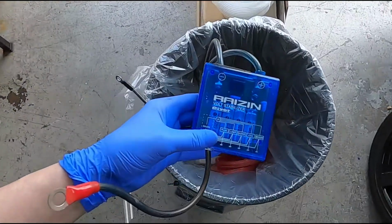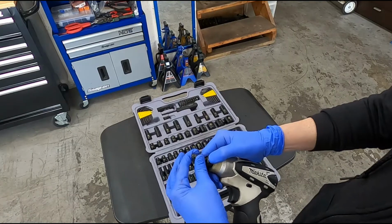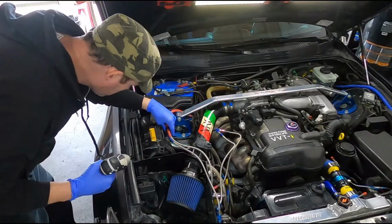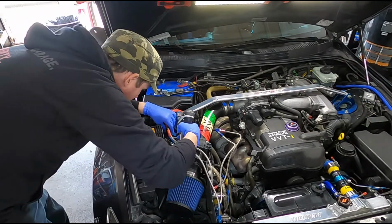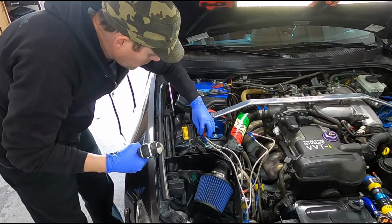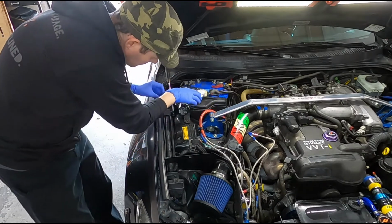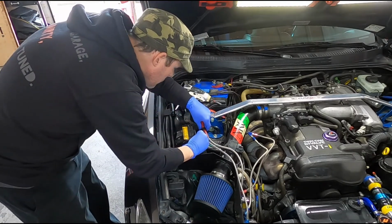The basic idea behind a voltage stabilizer is that during periods of high draw in the car's battery, there will be fluctuations in voltage, called electrical noise, that a traditional lead-acid battery is not able to cope with efficiently. In theory, the use of a voltage stabilizer, which is a system of capacitors that switch the charge more rapidly, will eliminate these fluctuations.